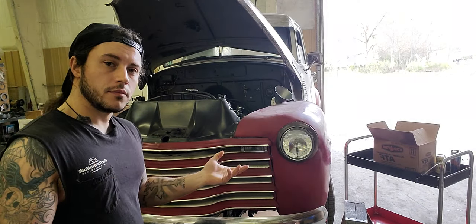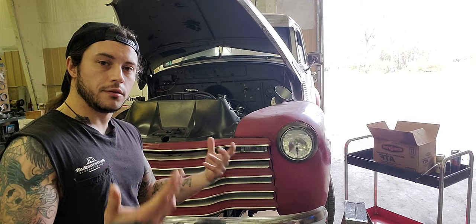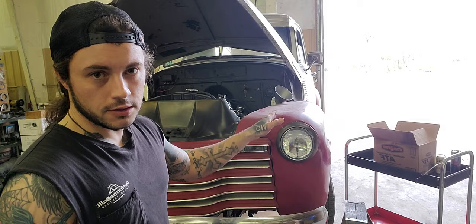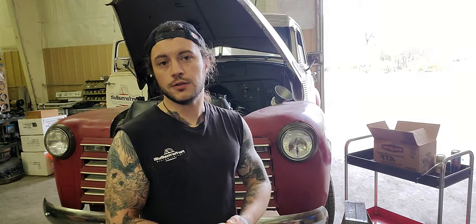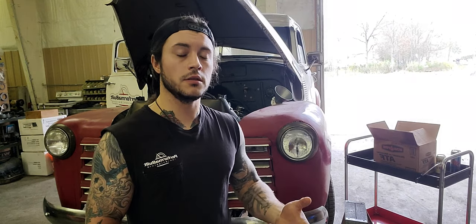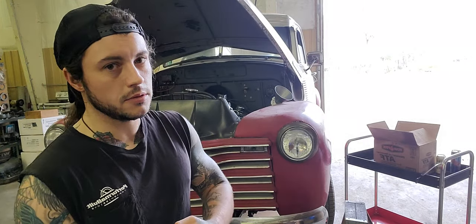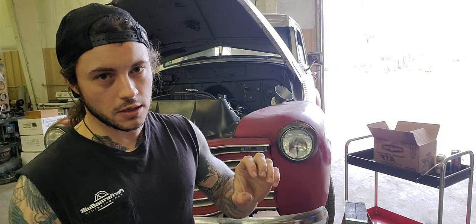And then after the fill up, we've ran it through the gears, verified our stick's full. We let the truck set, or whatever vehicle you're using set, for at least a few hours. And all this does is it lets the air burp out of the system on the initial fill up. You know, you don't want spongy hydraulics, you want rock solid ones. Sponginess and air bubbles create half-assed applied clutches. You don't want that.